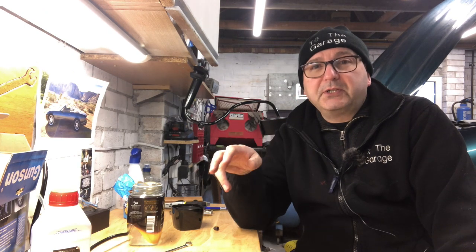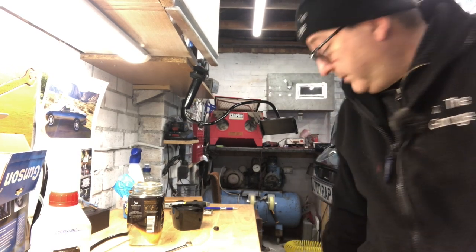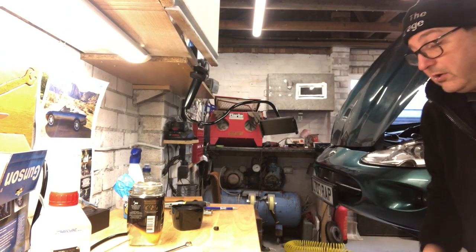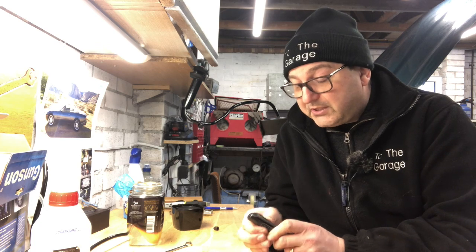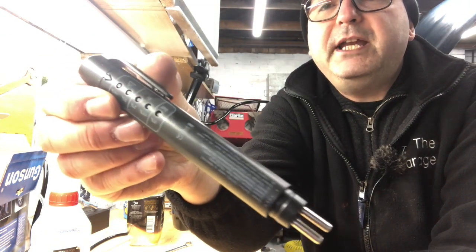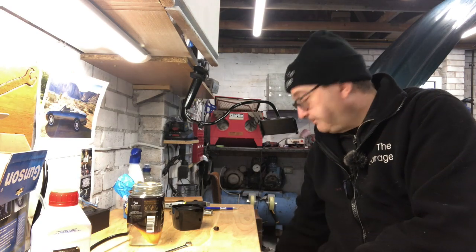I want to change all the fluid in my car. I've had all the brakes off, all the lines undone, and it's been stood with those lines open for quite some time. I also knew that the brake fluid was past its sell-by date. We did that brake fluid test using a little tester - a couple of subscribers have got themselves one, really cheap - you just dip it in, press the button, and it tells you whether your brake fluid has got water in it and how much.